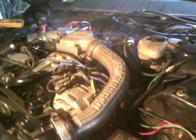The smoke, for those that don't know, is normal on the engine, especially as much as this one. I've had my hands all over it. You're just burning up all the oil residue. I don't hear anything about. I guess the lifters have pumped themselves up compared to last time.